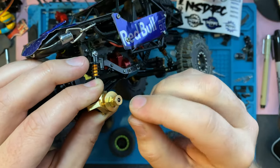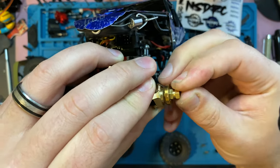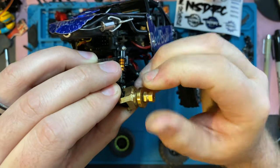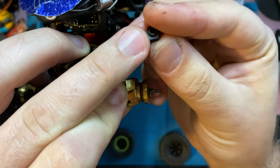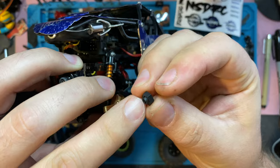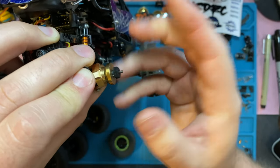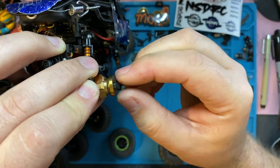That way when I tighten it down, I'm tightening down onto the axle pin and it's not binding in my axle. No matter how tight I get this, I'll strip out the axle or the wheel nut before I'll bind — because it's actually sitting on the pin itself. If the ears are sitting on there and pushing as you tighten down, it's going to push against your bearing, wheel weights, or whatever is between your wheel and your hub, and it's going to bind.